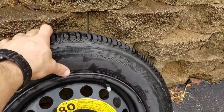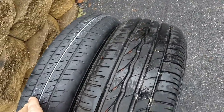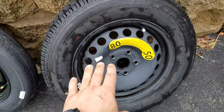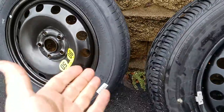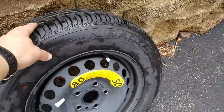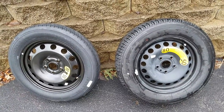This tire is way different than that temporary spare and can be used in much different ways. You can see the tread depth is way different, and the width of the tread is way different. If my ass is in a pinch, I would much rather have this wheel and tire combination in a hazardous environment. If a tire goes down off-roading, it's because it's been in a hazardous environment. A lot of times off-roading we'll take two spares, but this is the bare minimum I think is adequate.